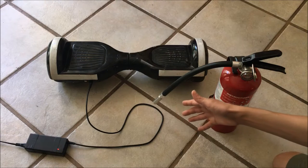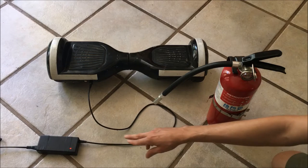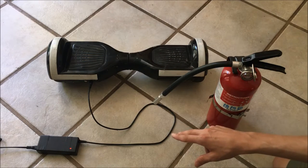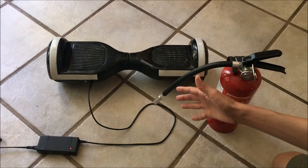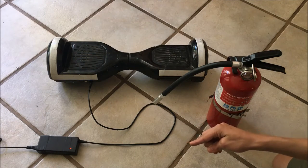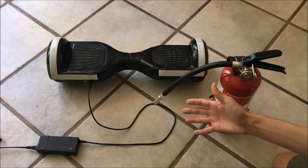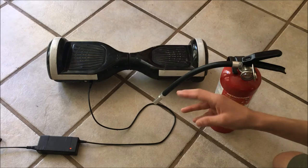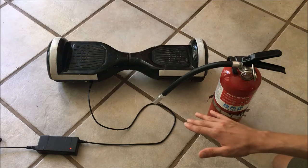The first and arguably most important tip is to stay in the general vicinity while you're charging your hoverboard. These chargers are simply 42-volt float chargers that trickle current into the battery pack until it reaches its maximum 42 volts. If anything goes wrong with the charger, or if the battery stays on the charger too long and continues to trickle, you could potentially overcharge the battery. The user guide for this hoverboard says not to leave the charger plugged in after it finishes charging — try to unplug it within about 30 minutes of when the light changes from red to green. The other reason to stay nearby is so that if a thermal event does occur and the battery starts smoking or catches fire, you can deal with the situation before more property is damaged.